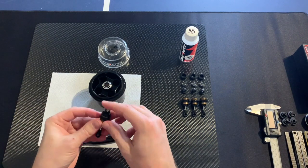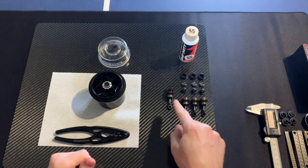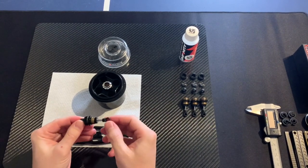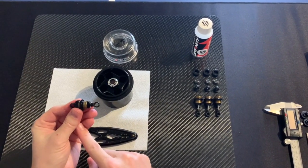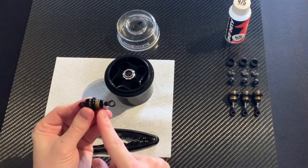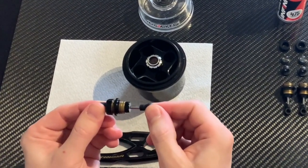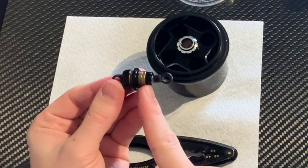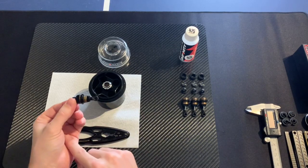So we just make the same steps on the other shocks. Check the length — I use 9.5 mm — and make sure when you push in you have the same. It may move out just a tiny bit; that is because the piston is touching the membrane a little bit. Just make sure you have the same gap on the other shocks and the same amount of rebound.